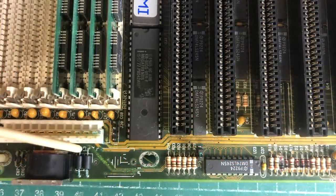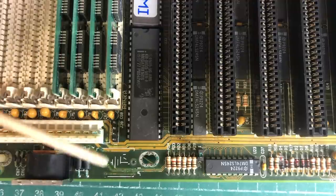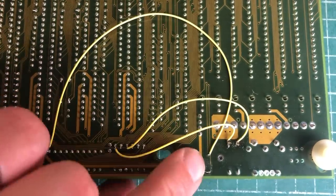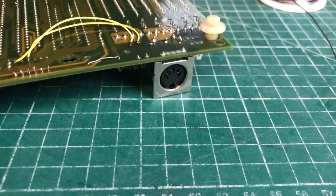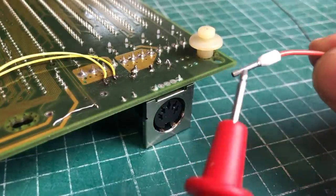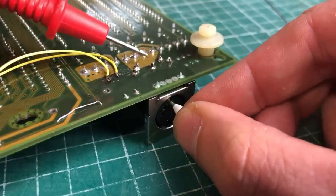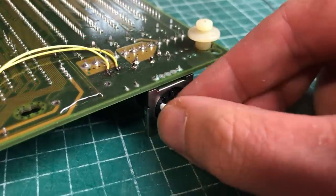Although we fixed the two traces from the resistors to the line filters, we still need to patch the connection from the IC to this point, and I also found that another trace was broken that needs to be bridged. I've added an additional patch cable to bridge these two points and solder them on the other side. I still had keyboard issues, so my focus went to the keyboard connector, which sometimes also causes issues when batteries have leaked. Sometimes the internals of that connector might be broken, so an easy way to test that is to use a cable inserted into the pins of the keyboard connector and check continuity with your multimeter — but those turned out to be correct.